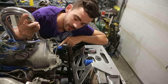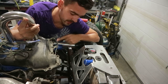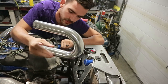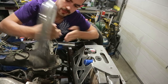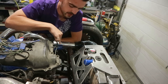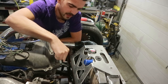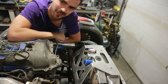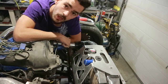Here's the issue we're going to run into: we've got to come from this coolant neck here over to this radiator. It looks like it'd be a nice simple 90-degree bend out of the coolant neck, up and over, 90 degrees into our radiator. Unfortunately, the bend radius on these tubes is going to push it too far forward on one end and too far back on the other, so they wouldn't meet up. Instead, we're going to do over-90s — about 100-degree bends — so it comes out, travels backwards across the car, and bends back into the radiator. We have enough bend material to do it; it just might look a little goofy, but that's the nature of the game.